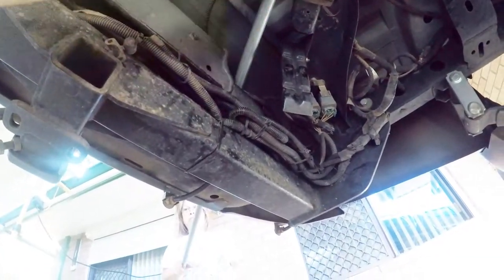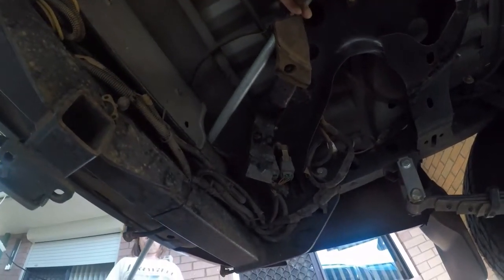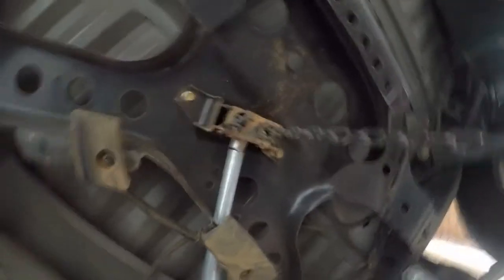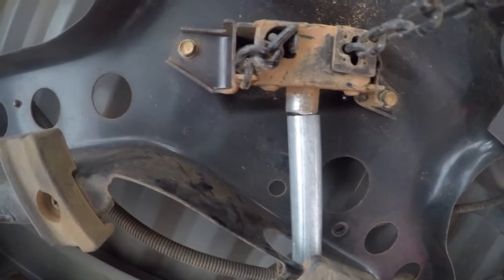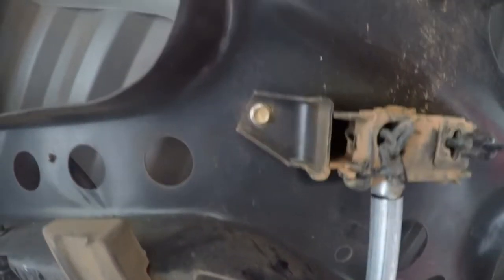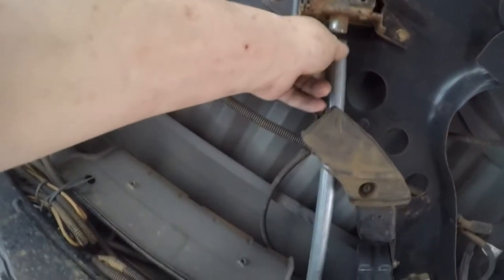Now to hold that into position, you cut your pipe back there on the socket and then you make a bracket that you fit to this and run a hole through there with a screw, and that way it'll be nicely supported there. Now, there's another thing that's a problem with this. Let's see if we can line it up. You can probably pick up in the picture, the alignment of the jack is way off. So what we can do is widen out the holes and bring this around square. So we're going to take this bracket off, widen out the holes, and then make it square. Okay, and make sure we'll take this back a little bit. That's it. There's our thing.